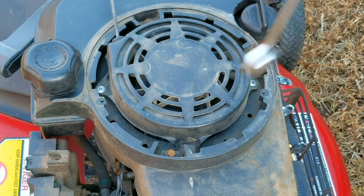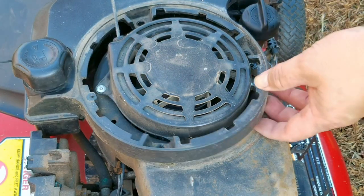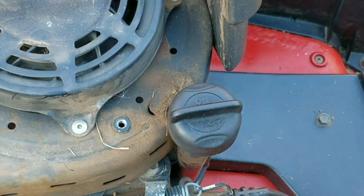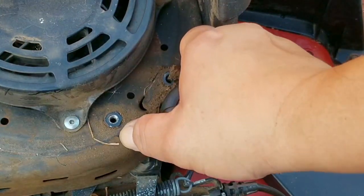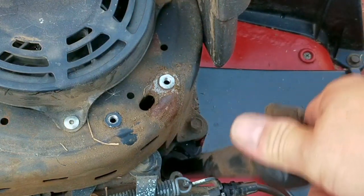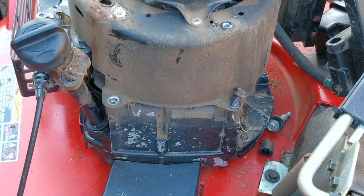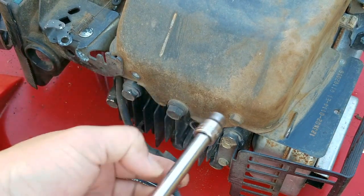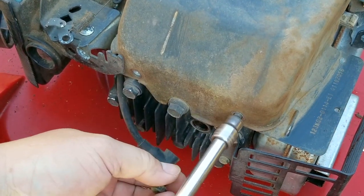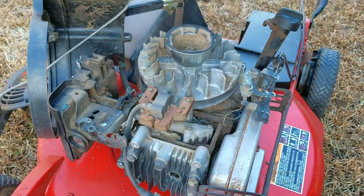The gas cap is designed to allow air to vent into the tank. As gasoline leaves the tank, air needs to be able to enter. If it doesn't, the engine will stop running a few minutes after starting it and won't restart unless you open the gas cap to allow air to get in. This used to happen to me as a kid and I never could figure out why, at least until now. After you check the gas tank by taking off the gas cap, this will typically allow just enough fuel to leave the tank that it drops the fuel level and allows the cap to work the way it's supposed to. The owner's manual would state to leave about half an inch of headroom below the top of the fuel tank to keep from having stalling issues.